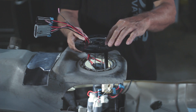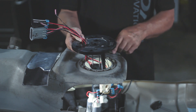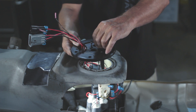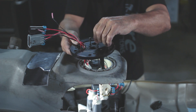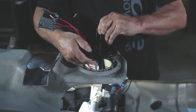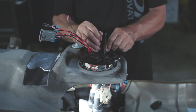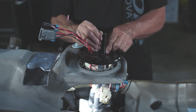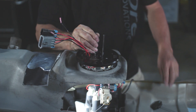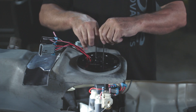Now that we have the level sending rod attached, make sure the orientation is proper, check for all your O-rings making sure they're in place, and making sure the wires are clear as you slowly pull the flange to the lower assembly. If one is in the way, move it out of the way. Then take the other bolts that attach the flange to the lower assembly and put them in place. Peek underneath it, making sure there are no wires being pinched anywhere. Now remove the assembly bolts and insert the other two screws.